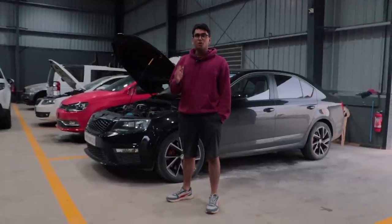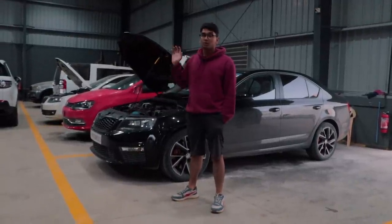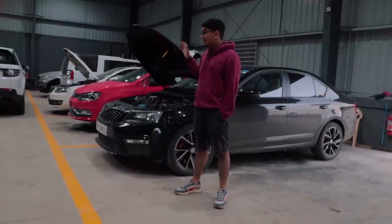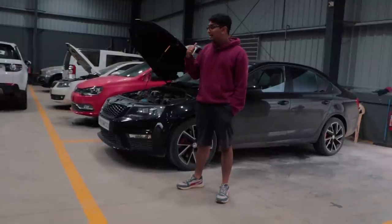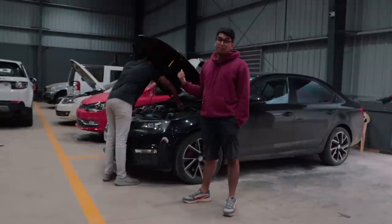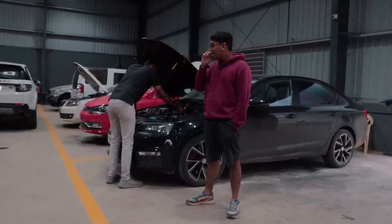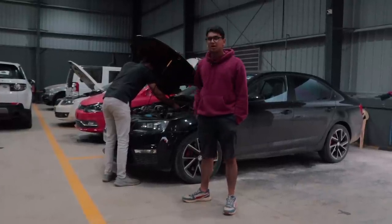So we've just come back from logging and testing, and as we suspected, cylinder 2's ignition coil wasn't working properly, so we've changed it for a stock one for the time being. Sometime down the line I will probably have to upgrade them to APR coils, but for now it's working fine. So now we've gotten the file from Venom Performance for the stage 3 map and the ECU TCU tune both, in fact, and now we'll just be installing that, and let's see how the car is running after that.